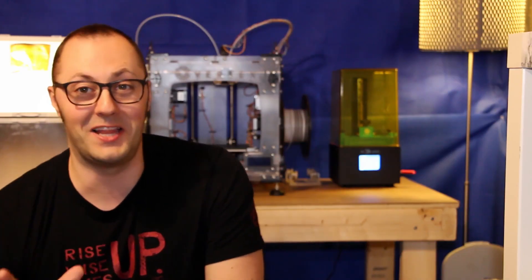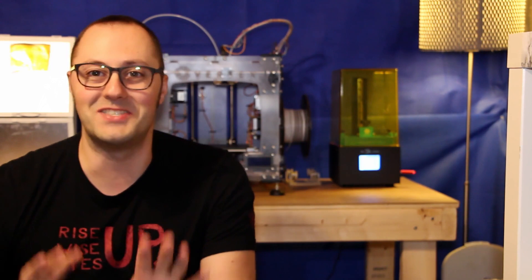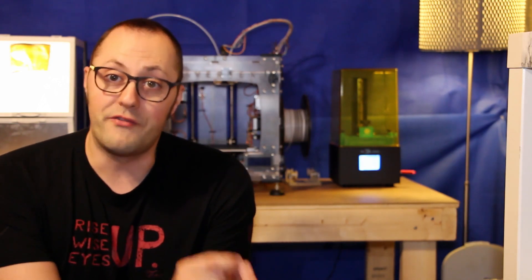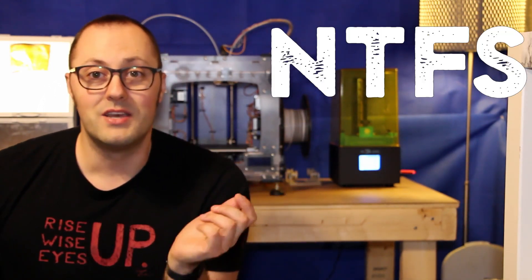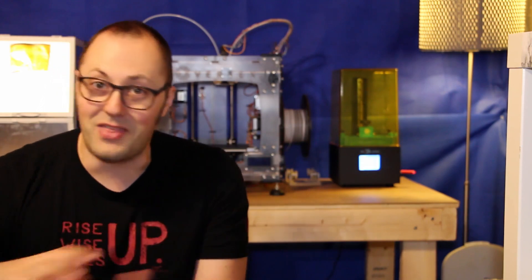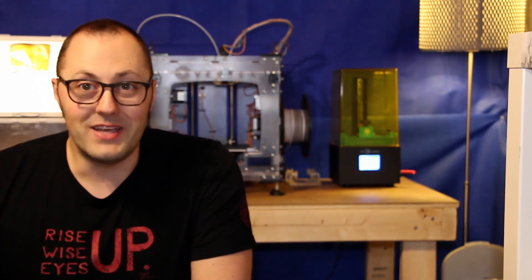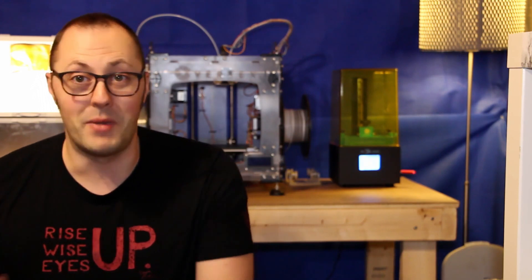Hey makers — Trevor from the future here with a little update. As you can see, the machine is running behind me. It is not some kind of catastrophic USB board failure or anything like that — it's not a big deal, but it was a little bit concerning given that that was the fresh out-of-box experience. The deal was the USB key that shipped with the Photon Zero was formatted in NTFS, and the printer requires FAT32 — it was the wrong file system. A quick drag and drop of the files onto my computer, a reformat of the drive, and then dragging the files back fixed everything. That's not a great experience, but it was easy enough to figure out. Just be mindful if you decide to buy this printer that that kind of weirdness might be part of it.